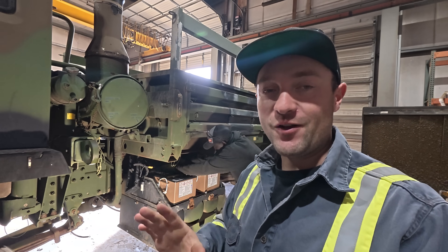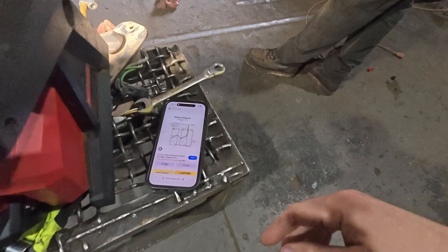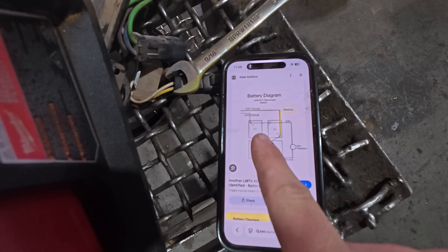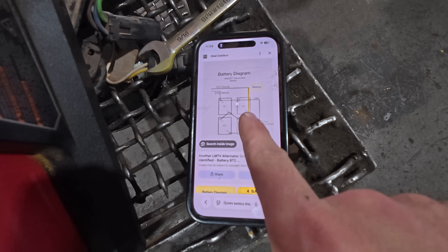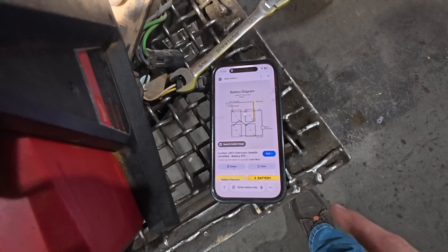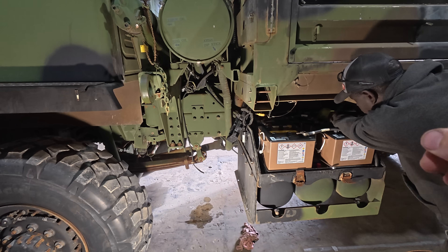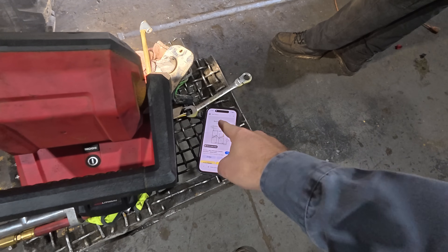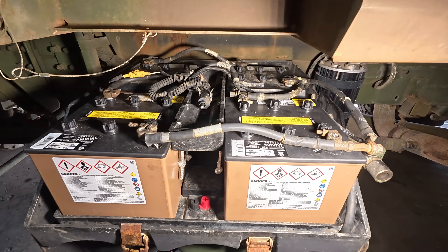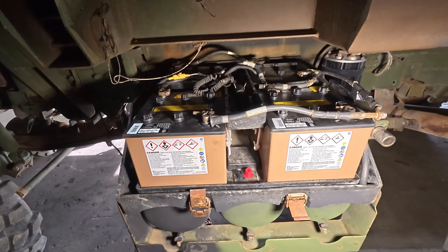We got all four batteries mounted up. It took us a little bit. I had to look up on a forum called Steel Soldiers — they have a diagram on how these batteries all line up. This kind of adds to my theory: it does have a 12-volt circuit that goes into these four batteries, connects to the first battery on the right-hand side. We only had two batteries running, so basically our 12-volt circuit was just being deadheaded with nowhere for the load to go from the alternator. Everything mounted in there perfectly, we even had the battery hold down. We just need to add a little nut to the back of that.